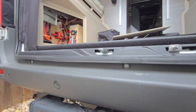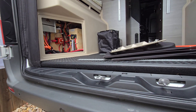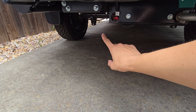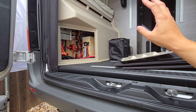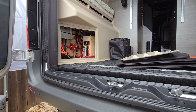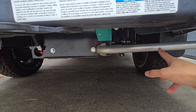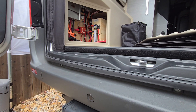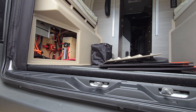Putting the batteries inside is a little bit nicer. Lithium is also heavy, but this current setup is 200-something pounds. I'm guessing I'll be shaving close to 100 pounds — taking out the 15-pound propane tank, the generator which I think is around 100 pounds on its own, and those two lead batteries. It's not an equal exchange, but it will still be lighter. Plus it means simpler wiring, less hoses underneath, cleaner setup — the benefits are a lot.